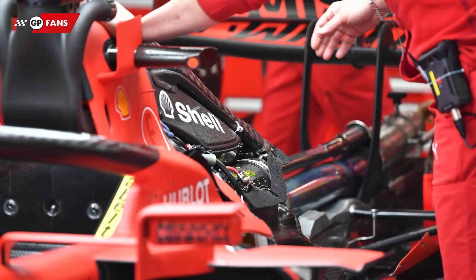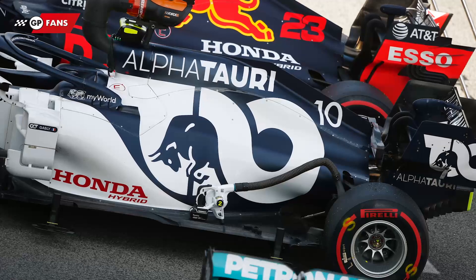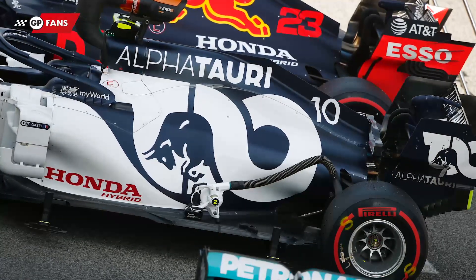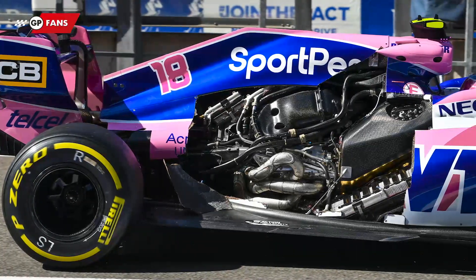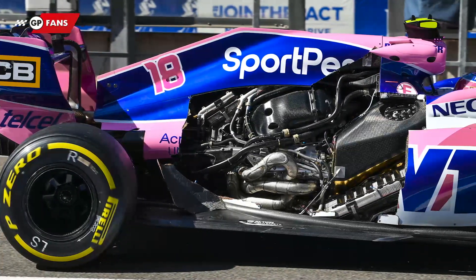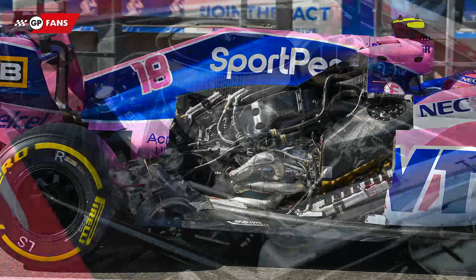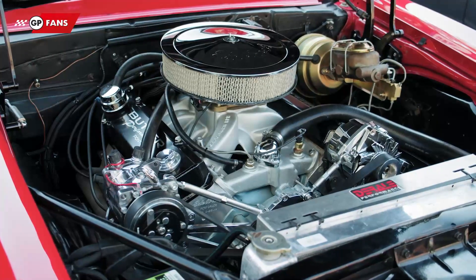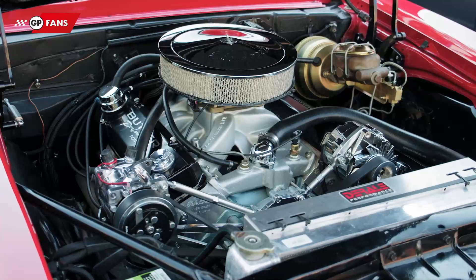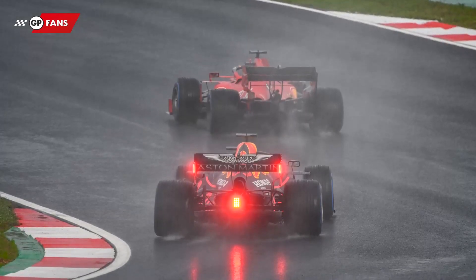All kinds of preparations have to be made. To begin with, the engine must be brought up to temperature even before it is started. This is important because the parts of the engine are so close together that the moving components can be damaged if temperatures are too low. With a normal car that danger is also there but to a far lesser extent, which is why you have to warm it up before you ask a lot of the engine. There's always so much demand from an F1 engine that it simply cannot run cold.